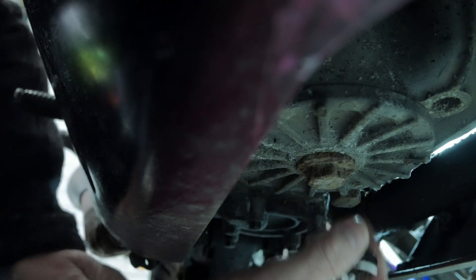The battery is a fresh one. I have cleaned the float chambers of the carbs. We have power. Will it turn over? Turned over. Will it start? Should I put a bit of choke on it, I suppose? What about that? Twelve years in the garage. A bit of fresh petrol, clean carbs, fresh oil, topped up the water. And it started.